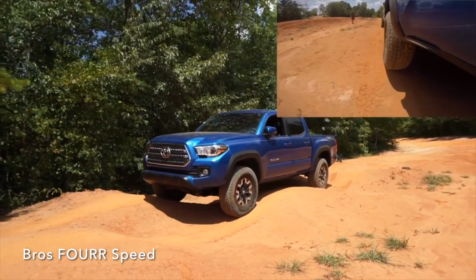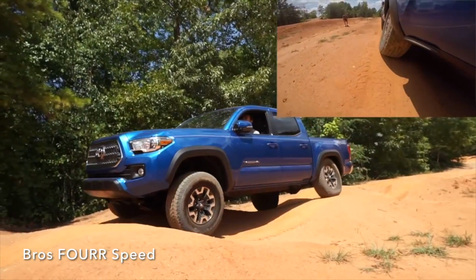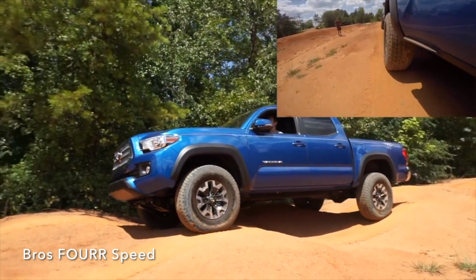On my last truck I ran a tire just under 33 at 11.5 wide, and I ran a 1.25 wheel spacer. I did have rubbing on my lower control arms and then had to do a little bit of trimming front and rear. So I don't want to run a wheel spacer again. I want to accomplish getting it poked out from the fender a little bit with the tire. So do you guys feel like the -12 with a 4.5 inch back spacing would be too much?